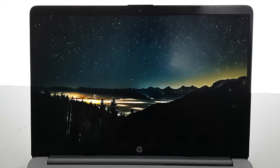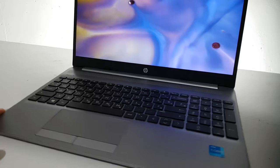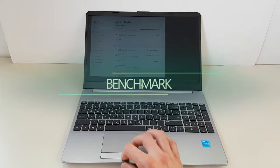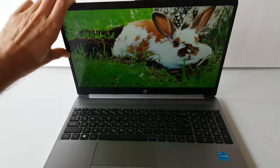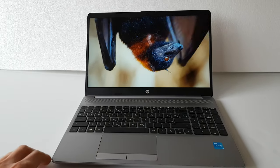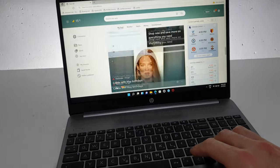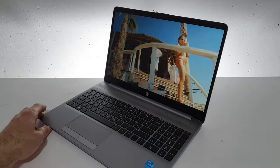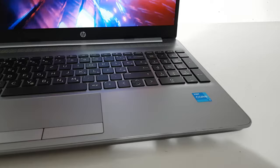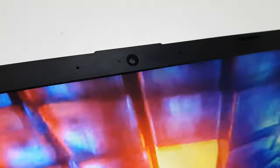The 15.6-inch screen covers less than 60% of the color gamut and is dimmer, measuring around 200 nits in light meter tests, which is enough for comfortable use in a bright room. For outdoor use, I would avoid direct sunlight. The color accuracy is not the best for designers, but for watching videos or playing games it has more than enough colors. The full HD screen resolution is fine and sharp, and viewing angles are wider than you would usually find on budget laptops, at least if you have IPS in the screen specs instead of TN.